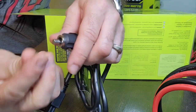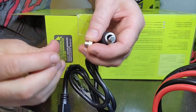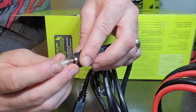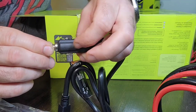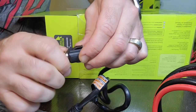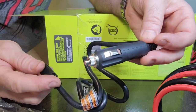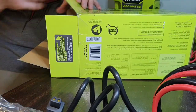Put the cap back in — that little pin makes contact with the top of the fuse, and the bottom is spring-loaded. Just screw it back in. If the car adapter stops working, 90% of the time it's going to be a blown fuse. The adapter then plugs into the side of the unit, which we'll see in a second.